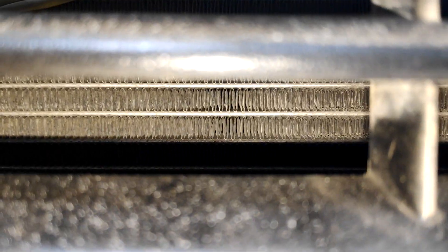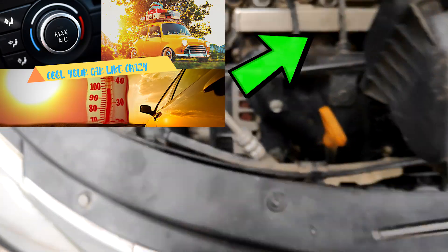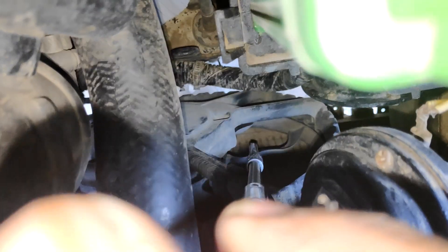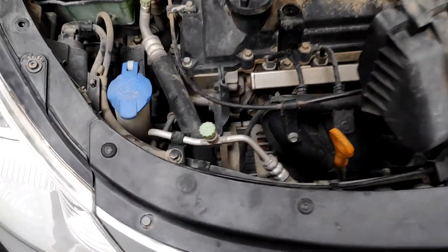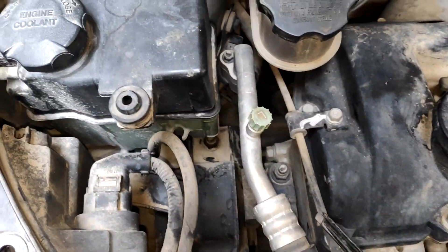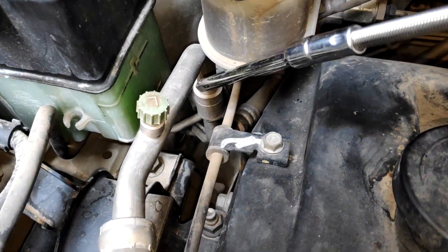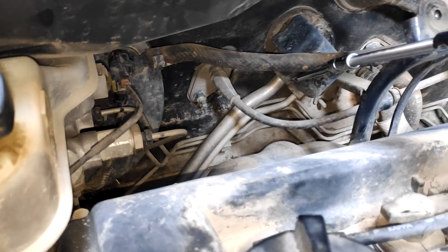The part that you see inside the grill is the AC condenser. If you want to see this AC condenser clearly and other parts associated with the HVAC system of your car, you can watch my video on how to cool your car like crazy by clicking the i button above or following the link in the description. The part inside the condenser is the radiator. This is the radiator fan. This is the high pressure line of the AC system and this is the low pressure line. The diameter of the low pressure line is greater than the diameter of the high pressure line. If you follow the low pressure line, it goes to the evaporator which is inside the dashboard and cannot be seen without opening the dash.